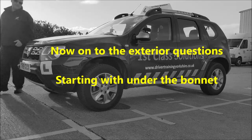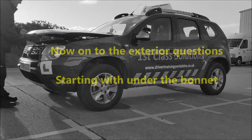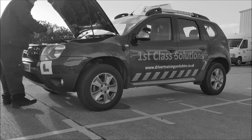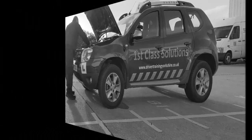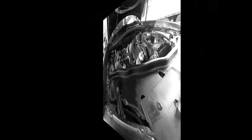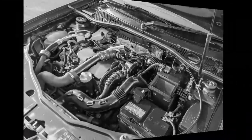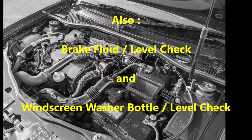Now moving on to the exterior questions. We start off by opening the bonnet. There are several what we class as level checks underneath the bonnet. You'll be asked to identify at least one of these and tell them how you would check it. One could be the brake fluid, one could be the windscreen washer bottle. And if it's the engine oil or the radiator coolant, you must add that you would check it when the engine's cold.